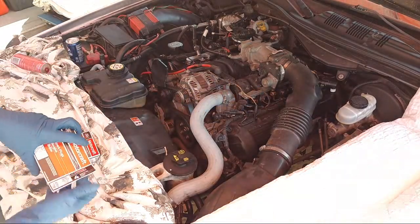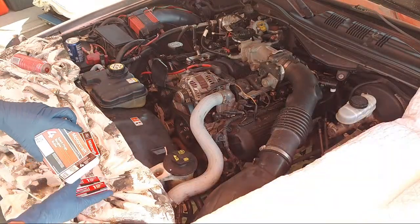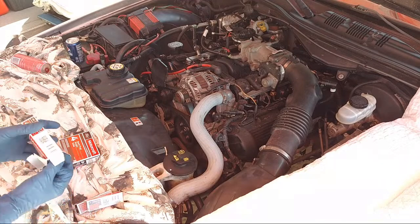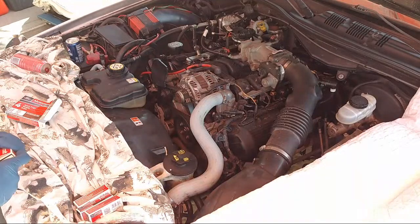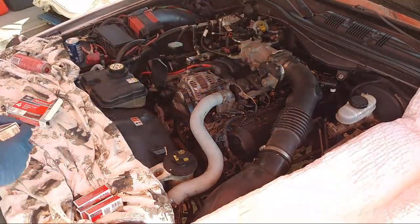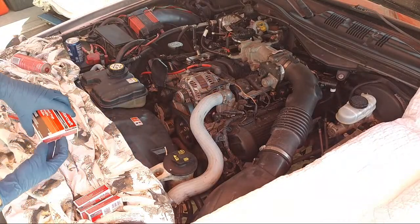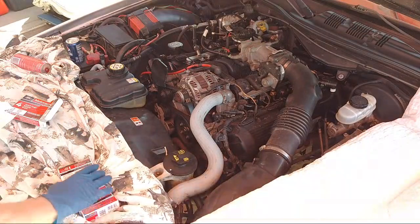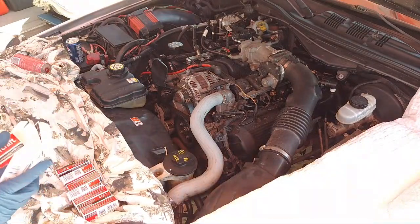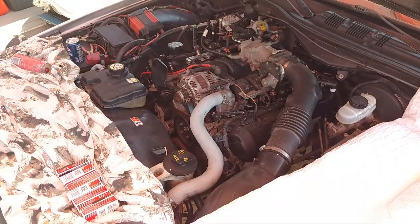I'm having a slight stutter going on, and what's happening, I think, I had to power wash my engine like a month ago or so, and I think I power washed it too hard and got water into where the spark plugs were at, and it failed one. It gave me a code that it failed. So when I replaced it, it was better. So I'm having a slight stuttering going on in the engine, and I think it might be one or more of the plugs. Not too bad, it's drivable, but it bugs the crap out of me.